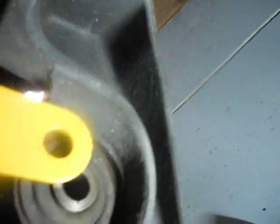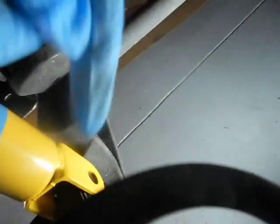Get our new bushings. This end goes up to the frame and that end will go down on top. So new washer, new lock nut. Let's throw it on. Well, look at that. There's a bushing in there, and it's not part of the shock, so that eventually probably wears out and you gotta press it out. It's a crappy design. It comes out this way, it looks like. You gotta press from this side out. Wow, maybe a little ball joint press will work for that. Interesting. So there's a bushing in there, shock bushing.